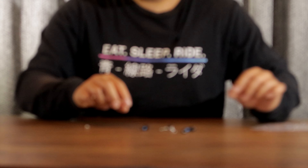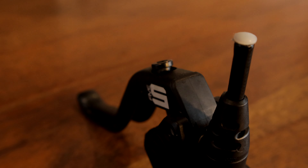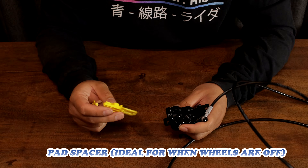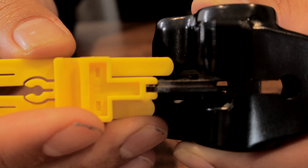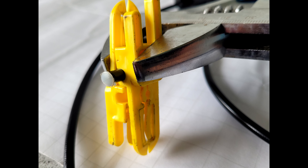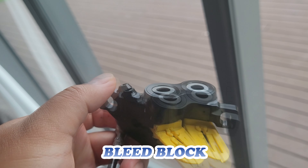What do we have here? Two bolts, washers, a pair of needles, olives, and a bung for the hose — so when you thread it in it will not collect dust. These are the Magura pad spacers. Don't throw them away because they serve a lot of functions. First use: a standard pad spacer while the pad is in. See that notch in the middle? That is a pad thickness measurement device — if your pad is less than that, you need a new pad. You can also use it to stabilize your hose when inserting the needle. And last but not least, you can use it as a bleed block.